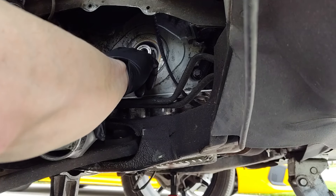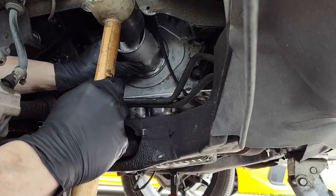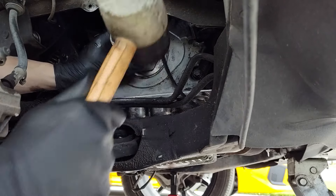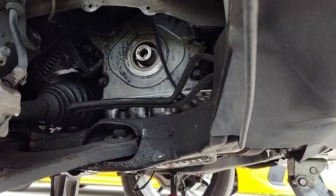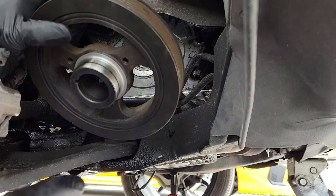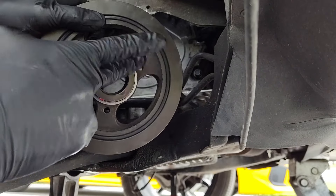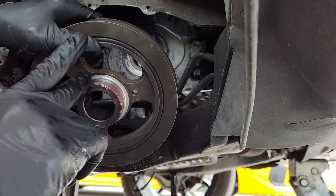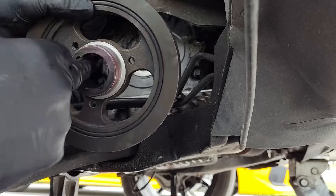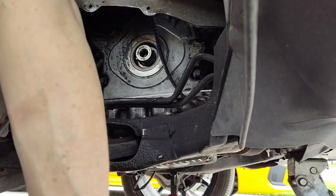Slightly raised on the top left, so just even that up. After you've cleaned off your crankshaft pulley — I put a speedy sleeve on this one — you're going to grease it around there so that it slides on the new seal during installation, and grease in here a little bit so that it actually slides on.